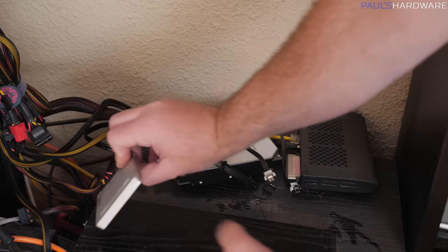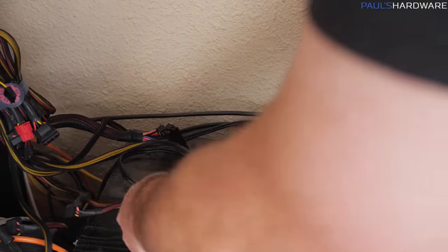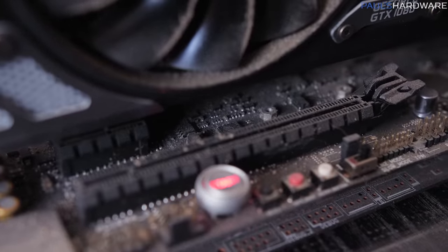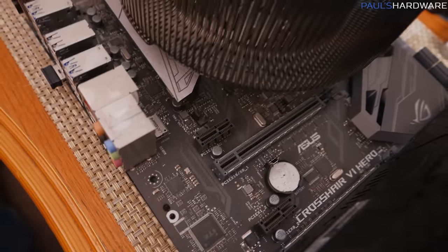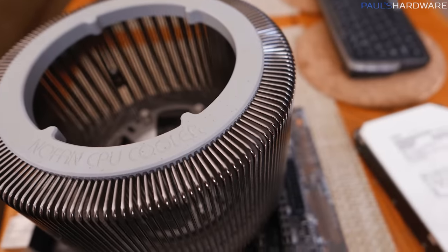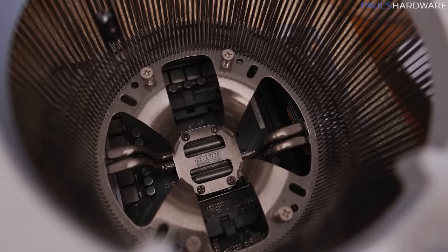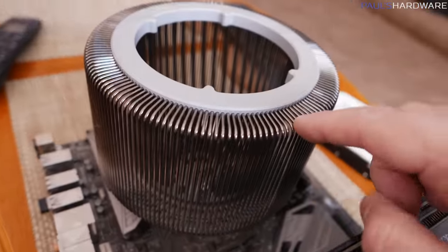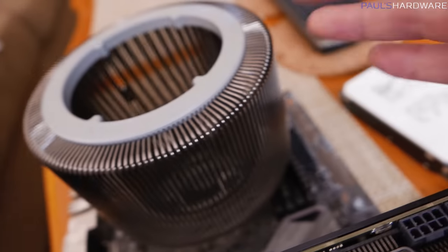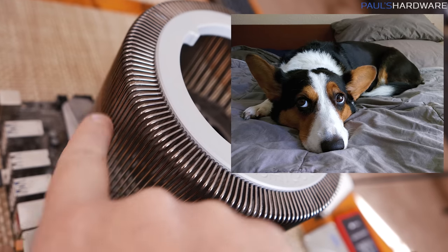As you could see back there where I had this all set up, these were literally just hanging off the back of a subwoofer by their connectors, which is more safe for SSDs than spinning mechanical hard drives. Now when it comes to our motherboard, CPU, memory, and graphics card, we can see a lot more dust buildup, and part of this is because these have been sitting horizontally so dust can just fall and collect. The thing I've actually been most impressed with regarding dust buildup has been the NOFAN CR95C - first shown in my 'Can Ryzen Be Passively Cooled' video - because there's no active airflow over these fins, there's really not that much dust buildup.